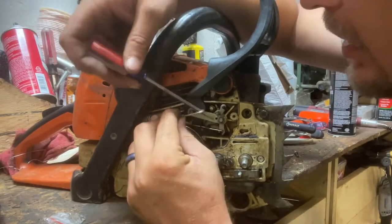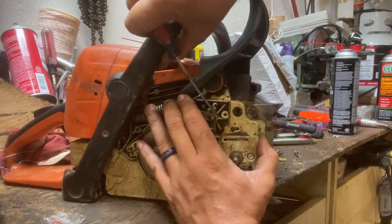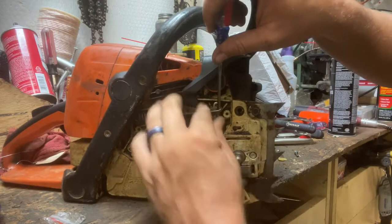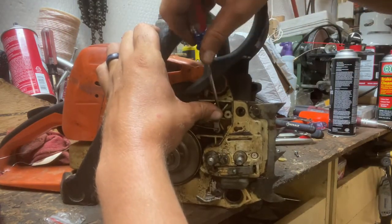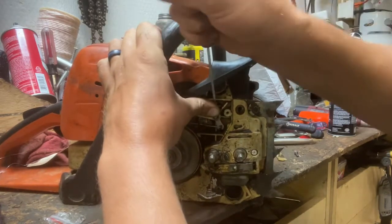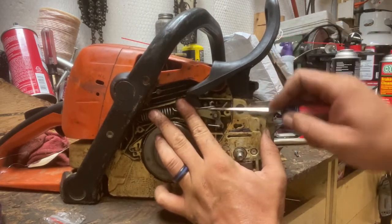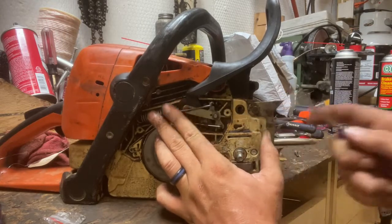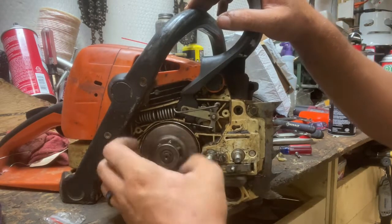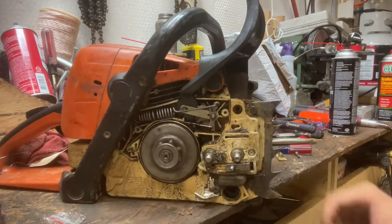The back of the spring hook's there, then we're just going to pry until we get that hook over. Then I'm going to attempt to get this screwdriver out. Now we're a little low which is no problem - just start wiggling and it will work its way up. Now we're back where we're supposed to be. So brakes off, brakes on - works like it's supposed to now.